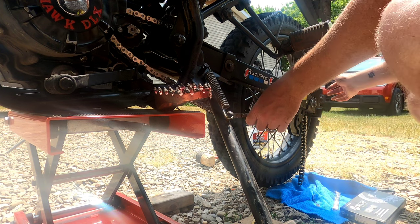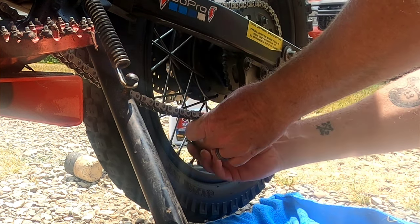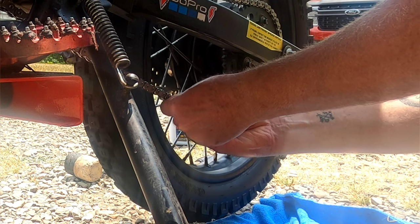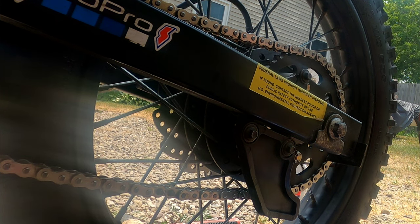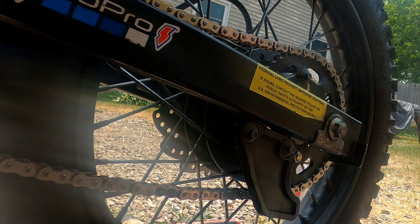You need to make sure your wheel is pushed all the way forward so you can get the master links together — it's kind of a pain doing it by yourself. If you've got a friend to help, by all means. Make sure you get the o-rings on both the back and front parts of the chain. The o-rings are what hold the grease on the chain better than a regular chain. They recommend lubing every 300 to 350 miles, and if you're in the dirt, wash and re-lube more frequently.